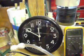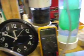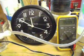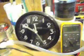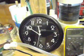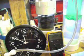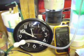Remember the key point when doing these efficiency numbers: take into account the temperature of the cell. If you're boiling water and somebody says 'my cell gets 12 mmW's,' but 50% of that is water vapor, that's not really something to brag about — you want a cell putting out pure hydroxy gas. Coming up on 45 seconds, we're about three-quarters empty. It's about a liter a minute here, emptying this 1.05 liters in just over 60 seconds.